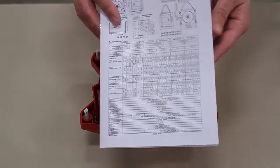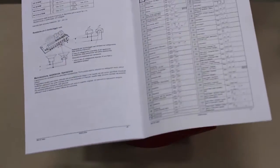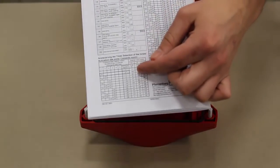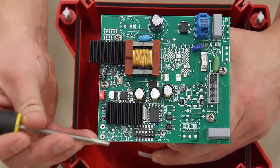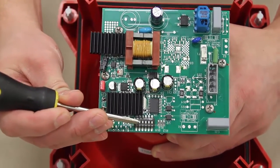As you just saw on the website, we will be selecting Tone 2, which is located in the back cover of your PA20 manual, along with the corresponding dip switch setting located below. To set your PA20 to Tone 2, simply change the number 1 switch on your dip switch to ON.